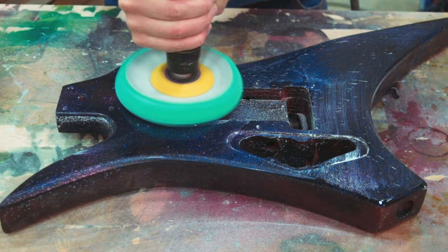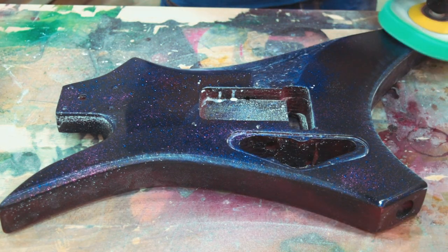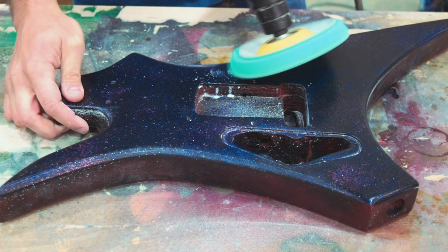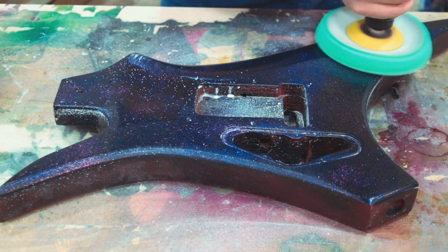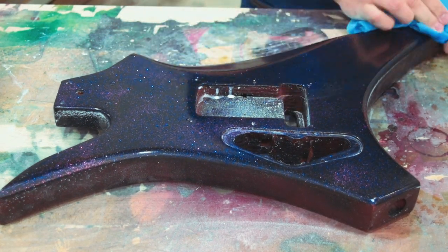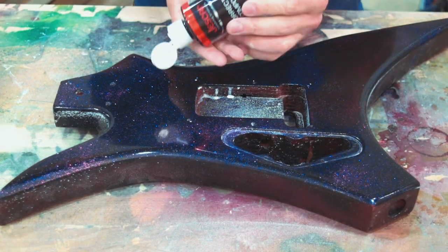There are a lot of different compounds and they all work relatively well with the exception of a few misfits. But don't try and use something like a wax or the polymer sealant to do this part of the process — you need an actual compound, and you'll want to move on to a polish from there to get it a little finer. The polymer sealants and waxes are designed for after you have all of this already completed, or later on when you need to kind of refurb it a little bit — then that kind of thing is useful. So I'm just cleaning off my compound.